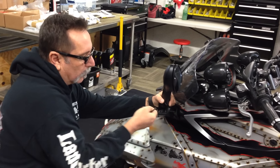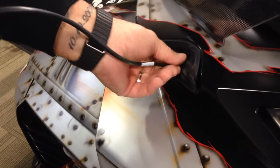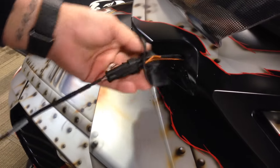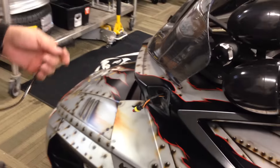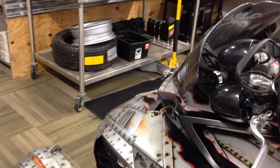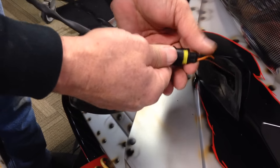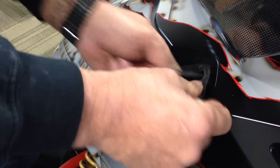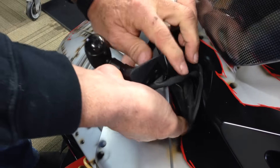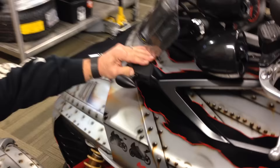Basically you're just going to pull these two bolts out. The little rubber pops off because it's been taken apart so much, but you're just going to feed this through here. There's your plug — put that rubber back on. You just unplug your stock plug, grab the turn signal, it's already pre-wired, everything's ready to go. Plug this back in, stick it in the hole, stick your wire back in. You reuse the rubber gasket so it's a nice sealed connection, then stick the bolts back on.